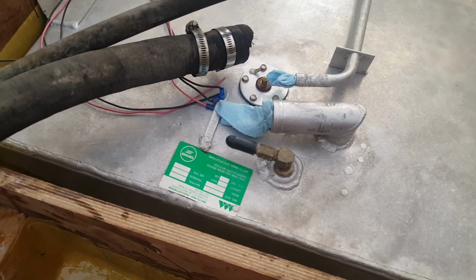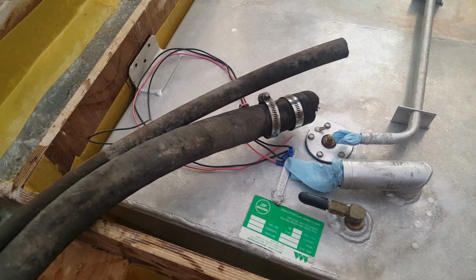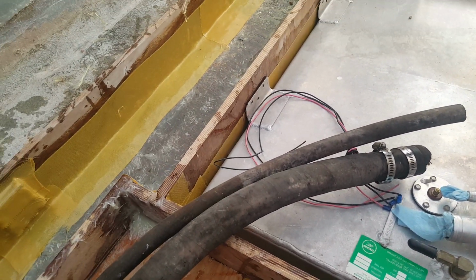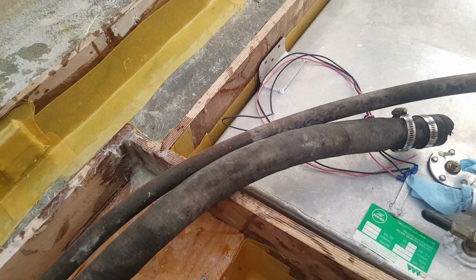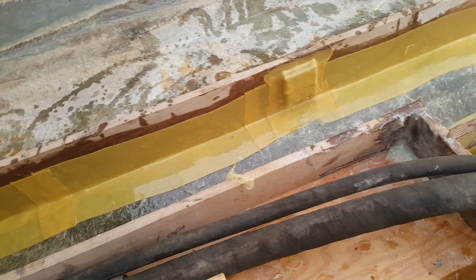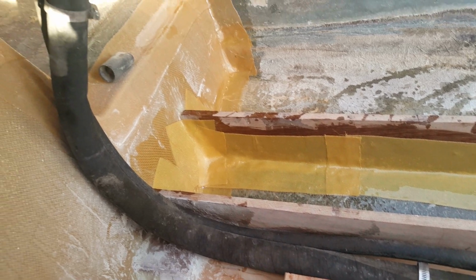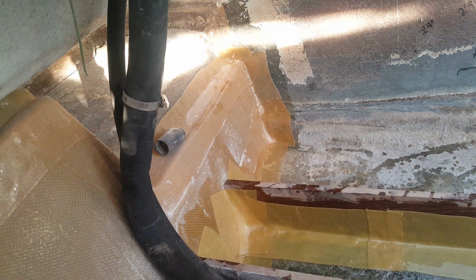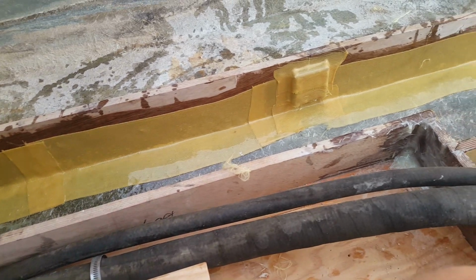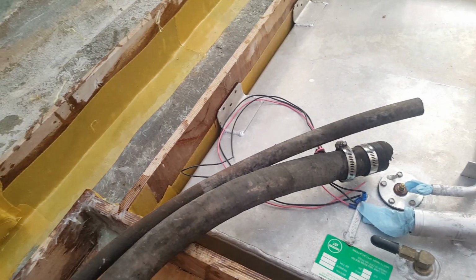The reason why, by the way, is that this is a 1994 boat. If you see my carburetor rebuild video, it goes over the whole reasoning here, but rubber that was designed in the early 90s was not designed for use with alcohol or ethanol. Now the majority of all fuel that goes into your boat is going to be at least 10, maybe 15% ethanol. It's great, but what it does to rubber is it dries it out and also cracks it, which is not good for a boat because that creates fire hazards and all kinds of stuff.